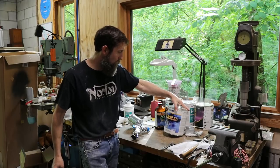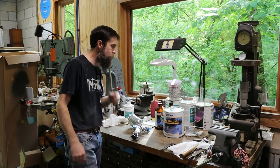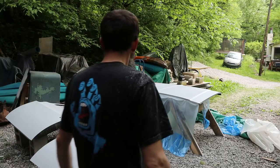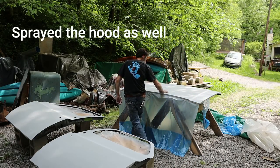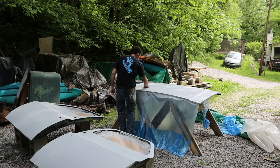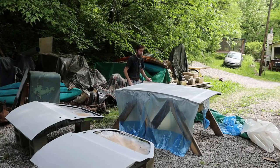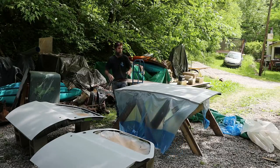You can spray this direct to metal as well. Properly sanded metal, that is. You don't want to spray it on rust, but you get the idea. Worked out pretty good. Like glue, really. So I literally just sprayed this 5 minutes ago, and I can already touch it. Got some stuff falling out of the trees in it, but this is primer, not paint. It's going to be sanded. It didn't go down quite as smooth as what I would like, but it looks good. And after we put the sandpaper to it, it won't make a bit of difference anyway.